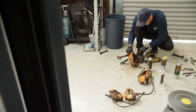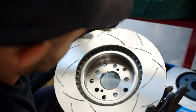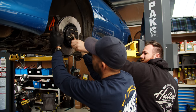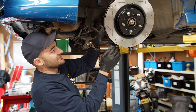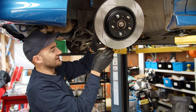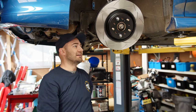If your secondhand brakes are in good condition, you can throw them on, bleed the fluid, and be on your way. Mine are a bit chewed out, so it's the perfect time to put on some new pads and rotors and a perfect opportunity to upgrade both. I'm installing some slotted rotors and pads made for street and light track duties, exactly the purpose of this car. A lot of the time when you buy these parts they're transported without wheels, and the shields on the back can get bent — it's always worth checking them, because otherwise you put your brakes back together and as soon as you start driving it screeches like crazy and everything has to come off again.